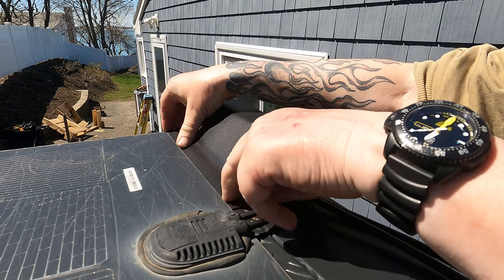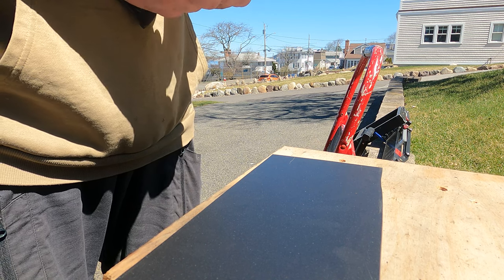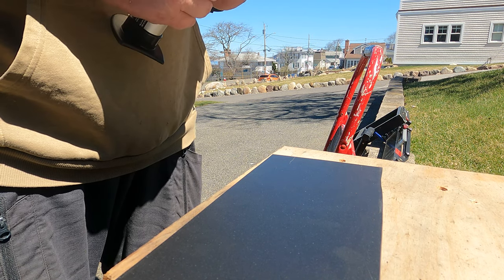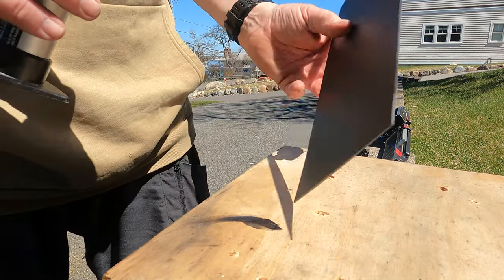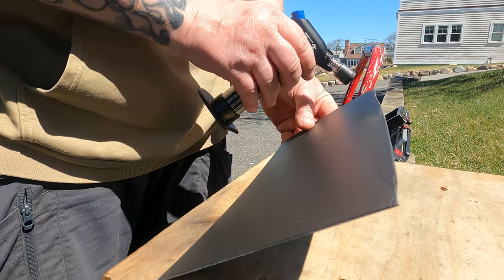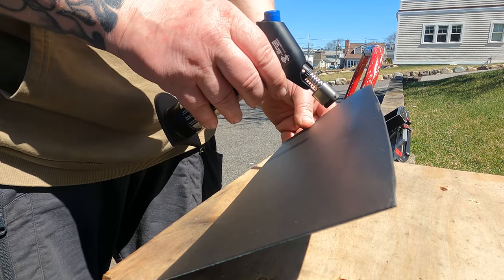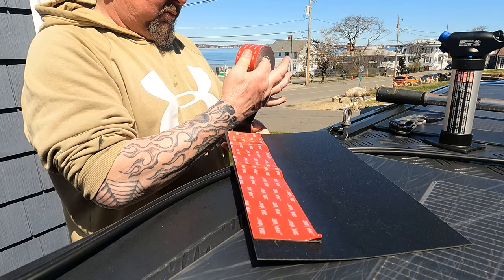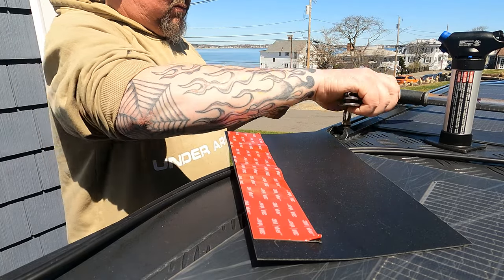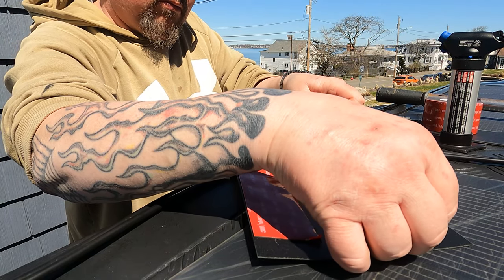After figuring out how wide I wanted the Kydex sheeting, I needed to figure out what angles — I wanted the Kydex to bump up over the wiring just a little bit, so this is all personal preference. Once you figure out where you want to bend the Kydex, you simply take your heat torch or heat gun — either one will work, electric or butane — mark your Kydex and then just run up and down in a straight line where you want to bend it. Don't melt it, don't burn it — just heat it up and it'll become pliable. Make sure wherever you're going to mount it you clean it immaculately; the cleaner the better, the better the tape will stick. This 3M VHB tape is really strong — I've run it for two years and never lost the Kydex.